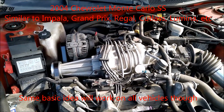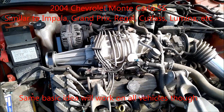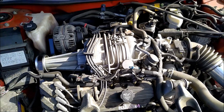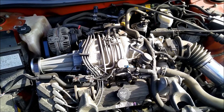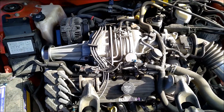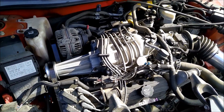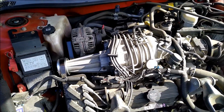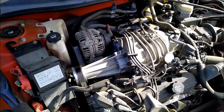Welcome to the Chris Camaro channel. I've got a bit of a repair video for you — basically my heater doesn't work. There are a few reasons why that might happen. Your water pump could be shot, but if your water pump is shot then your engine won't be cooling either, and that's not a problem for me — it's just the heater. So I'm more inclined to think that the heater core is blocked. If it were leaking I would probably have seen evidence of that somewhere, so I don't think it's leaking either. The car's got low miles on it, so it's probably blocked up.